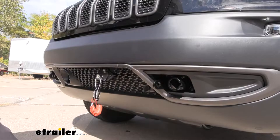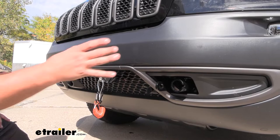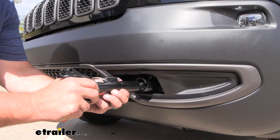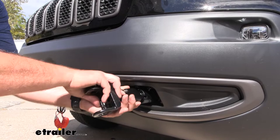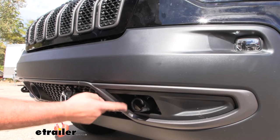This is what our base plate is going to look like when installed. Being a Trailhawk, unfortunately you do lose those red tow hooks, but it actually utilizes the same spot, which really minimizes trimming and overall it looks pretty clean. It allows you to get your arms attached when ready to tow by simply twisting them in — they snap in place. When not flat towing, just pull the pin, give it a twist, and you're left with a pretty clean look. The safety chain loop protrudes just enough to hook up without being unsightly.